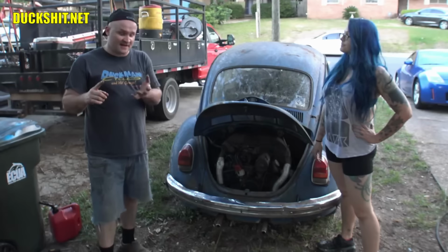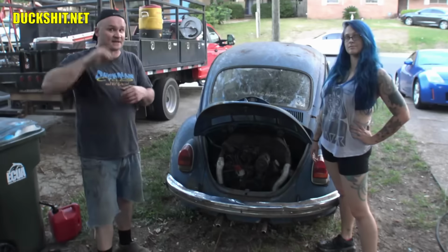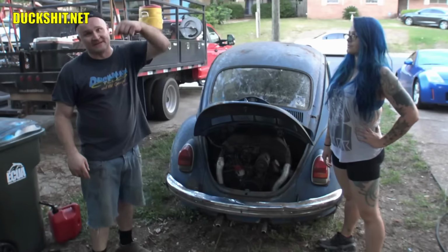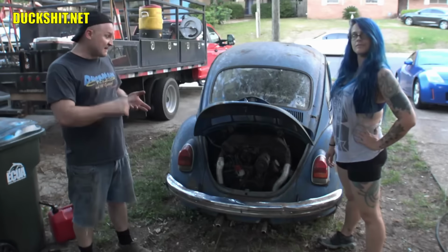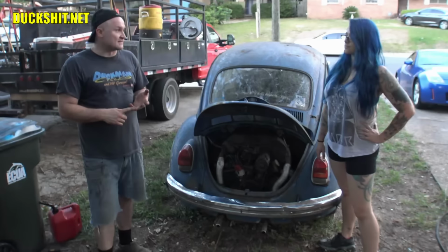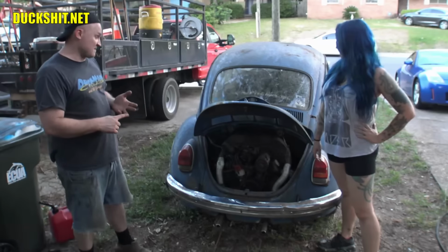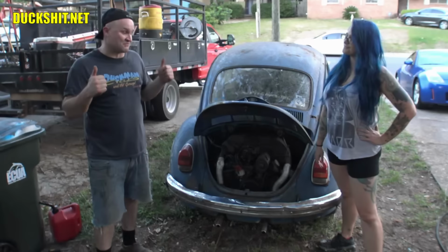Now, I'm either gonna need a hot start relay, and you guys have seen me install that in another video. If you haven't seen that, do a search for it on YouTube with my name, hot start relay, and you'll find it. There'll also be a link down below in the video description. But we're gonna replace the starter and the solenoid, clean out the carburetor, and figure out why it appears to be running on only three cylinders. So we'll adjust the valves and a few other things on it. But all in all, for a 30-year-old engine, it runs. And it runs good. This thing runs great.